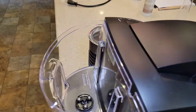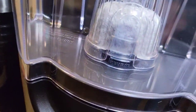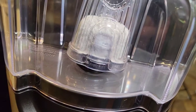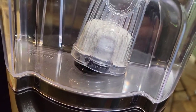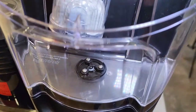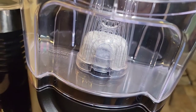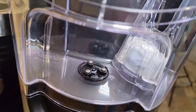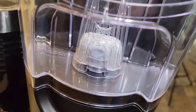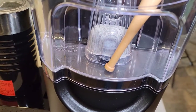The K Latte's reservoir is on the back. See that little black thing? You can do this with or without water in it — push it down until it snaps. We don't want to just let it sit there because water could bypass around it. That's how the water gets into the machine, through that black thing. Make sure you get a little snap, and when you lift up on it, it doesn't pull up. If you don't snap it on it'll float and could be off to the side, doing nothing. With it snapped on, all the water has to go through the carbon filter before it can go into the Keurig machine.